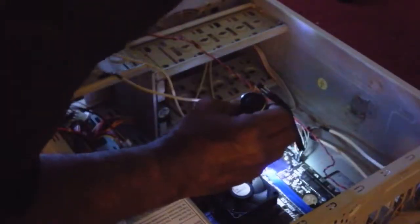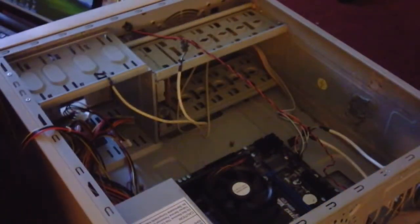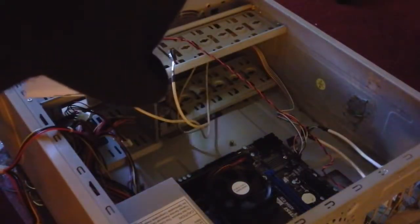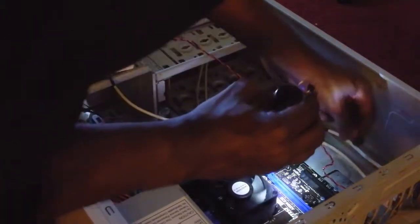Okay, so from here, it looks like from this way, USB port 1 and USB port 2 go right there. So here we go, JUSB 1 and 2. There's the ground, so let me make sure we put the ground in the right spot here, because otherwise it'll go poof. Ground is actually the first plug, because the first pin, according to this, is pretty much not used. So the ground, which is here, actually goes right here.